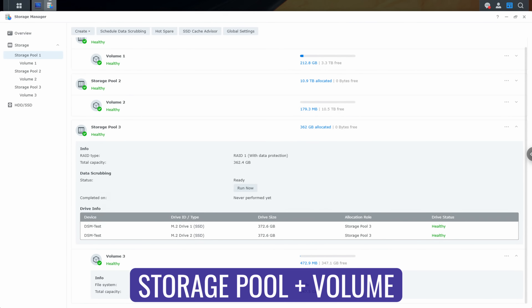To add even more complexity, you can actually use those NVMe drives as volumes on newer Synology devices. So if you buy an NVMe drive or drives for your NAS, you can use either read-only cache, read-write cache, or just a regular storage pool. All of them will give you better performance — it's just a matter of what makes the most sense based on your requirements, your networking, etc. Overall, on certain Synology models — generally Plus models — you can buy NVMe drives, add them to your NAS, and increase the overall performance.